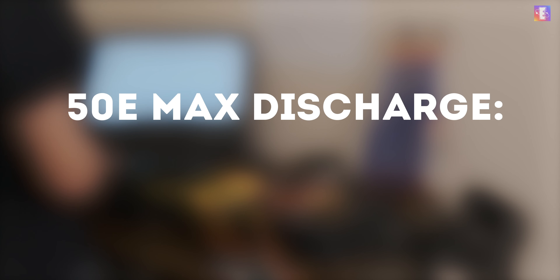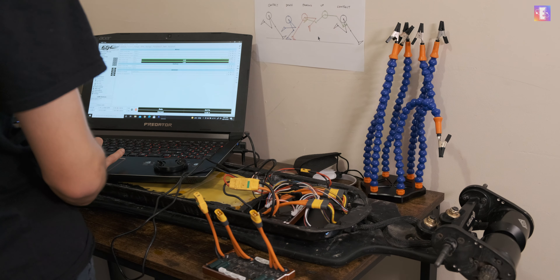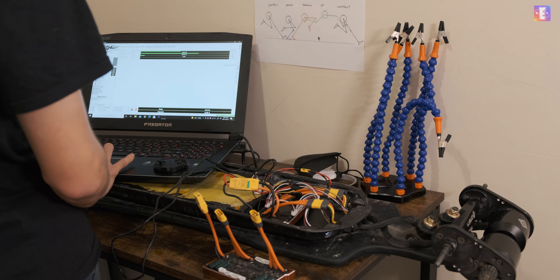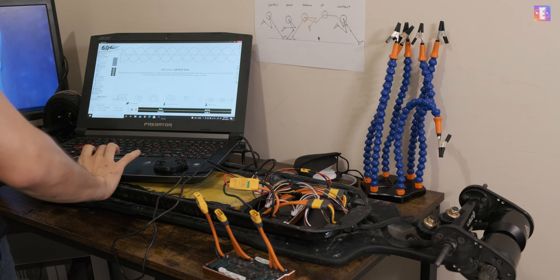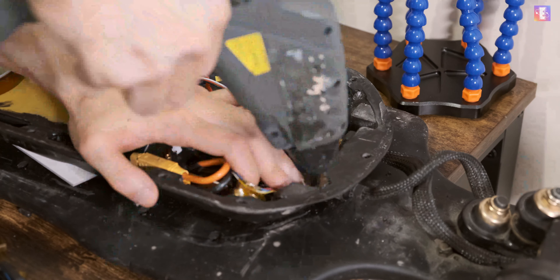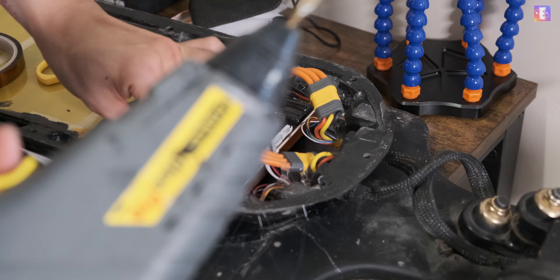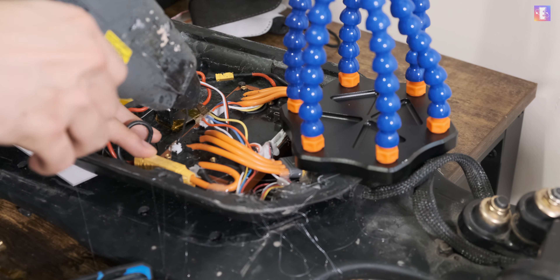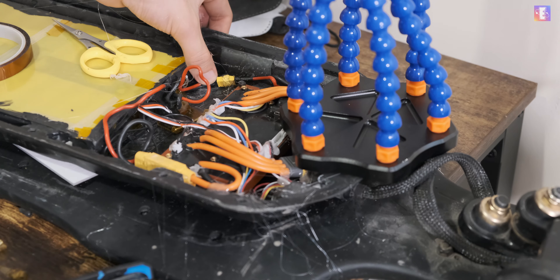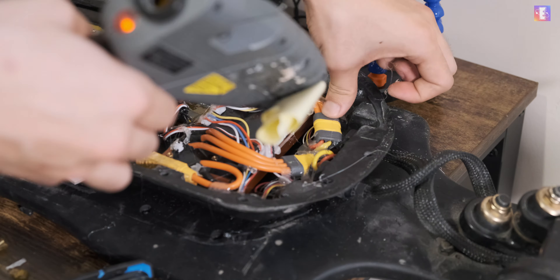With a bit of research, I found that the Samsung 50E battery cell used here is rated for 13.7A maximum discharge. As I'm only 60 kilograms and don't live in a hilly area, this isn't much of a safety concern for me. Although it is likely to shorten overall battery life, 21700 cells are rated up to 500 or sometimes 800 charge cycles — which, at 500 cycles, would last close to two years if I rode every single day to empty. Obviously this doesn't apply to everyone, so use your discretion depending on your weight, riding style, and terrain.